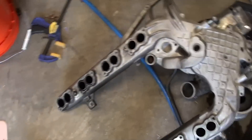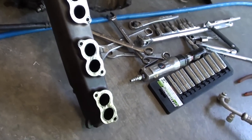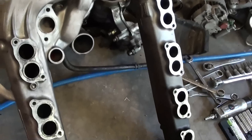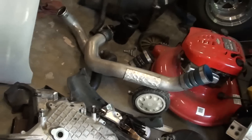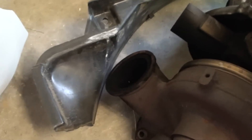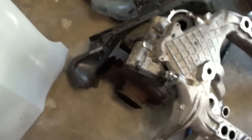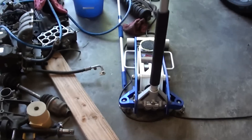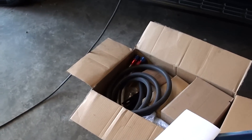When I put all this stuff back together last time doing the head studs, I had a horrible exhaust leak and didn't know where it was from. I figured it out real quick when I started tearing all this stuff down. I can't really see it from here, but this whole side of my intake manifold is black. It was actually leaking at the turbo exhaust inlet. See all the black gook everywhere — it's pretty dirty. The whole turbo on the back side is all nasty. If I was stopped at a red light without max AC on, you'd get diesel fumes in the truck, and that just really stunk.